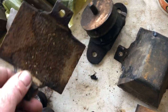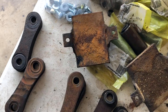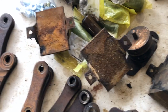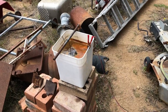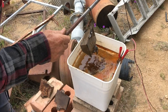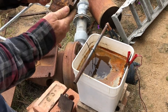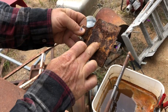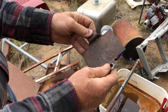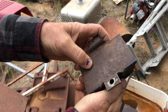These bump stops need a bit of clean up. I would like to put them on today — might give them a go in the electrolysis bath. A little science experiment going here John. Electrolysis, el cheapo style. A bit of scrap metal, battery charger, bump stop. There's an old crusty one — that's really bad rust. I don't know that's going to come good because the metal's too thin. And that's one after I've done a bit of electrolysis on it. Oh, that looks alright — it doesn't reduce right down, I need to do it a bit more.